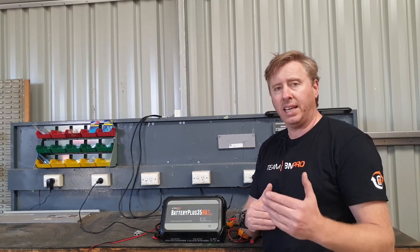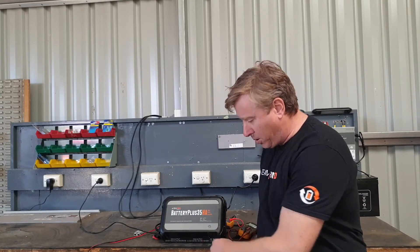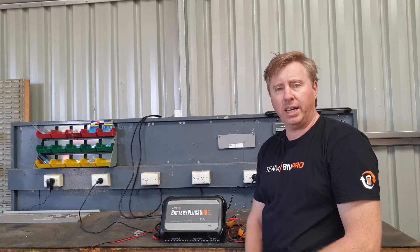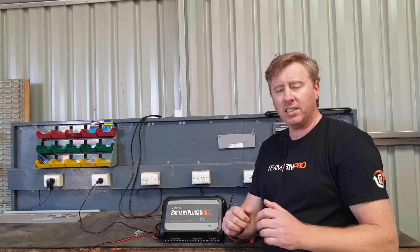If you find a particular circuit has tripped, identify it along the bottom — you've got negatives on the left and positives on the right. There are 14 negatives and 14 positives. Find the disconnected one, disconnect it to reset, and fix the problem with the load.